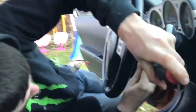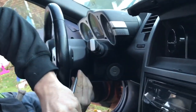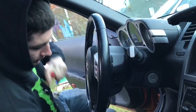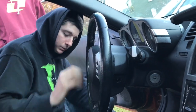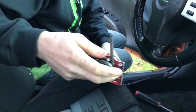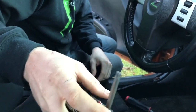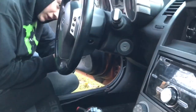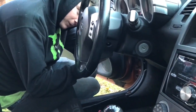We're popping these pins out. There's only two screws in the back of that — this holds the airbag in, then this whole piece will come out in the middle and I'll be able to get to the actual bolt. I had to buy this at Home Depot — it's a safety bit, like a Torx bit with a hole in the middle. I tried drilling it out and that didn't work.